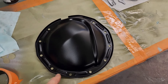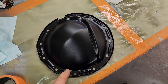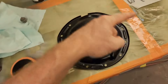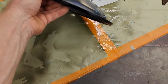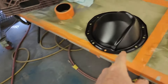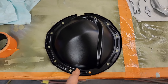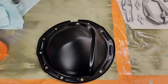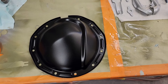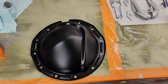We had to get another rear axle cover. Dave sent this down to me and it's a nice replica. What I do with these is I chem-clean them, then I put them in the blaster and give them a nice hit all the way around, inside and out. After I'm done doing that, I hang them on the rack and paint it out — it gets a coat of epoxy primer, and then we go right after that with the Imron. We're using a semi-gloss Imron. It replicates the exact color that it was back in 1969. So we have a lot of this to paint underneath the car — the rear axle, springs.